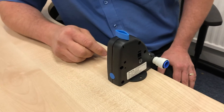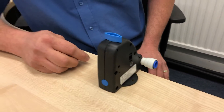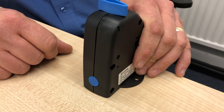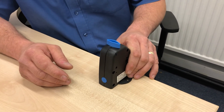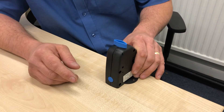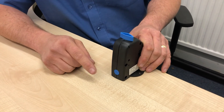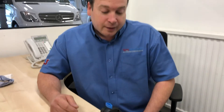As a secondary tip: if you've forgotten to drain it down and it's gone cold and you've left water in it, if the internal temperature of the van gets too cold, this button will pop out by itself — the knob on top won't turn, it'll just pop the button out and dump the water from the boiler to protect it from freezing damage. Don't just rely on it because your taps would be in the closed position and you could still have damage to pipes and taps elsewhere. But it would most likely protect the boiler from expansion and freezing. If it does that, just pop it back in and prime back up again.